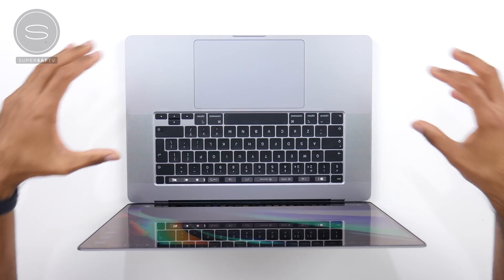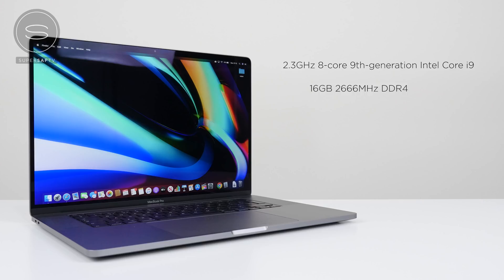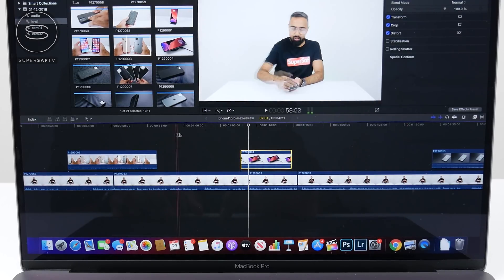Although the design is very similar from the outside, there have been some significant design changes on the inside. We've got a 35% larger heat sink and 28% increased airflow, which definitely helps with performance. In terms of specifications, my MacBook Pro here has the eight-core ninth-generation Intel Core i9 processor, 16 gigabytes of RAM, the AMD Radeon Pro 5500 with four gigabytes of RAM, and one terabyte of SSD storage — basically the base eight-core version, roughly around £2,800. Performance has been really, really good. I do lots of image editing in Photoshop and lots of video editing, and especially in Final Cut Pro X things have been very smooth. Export times have actually been really good as well.